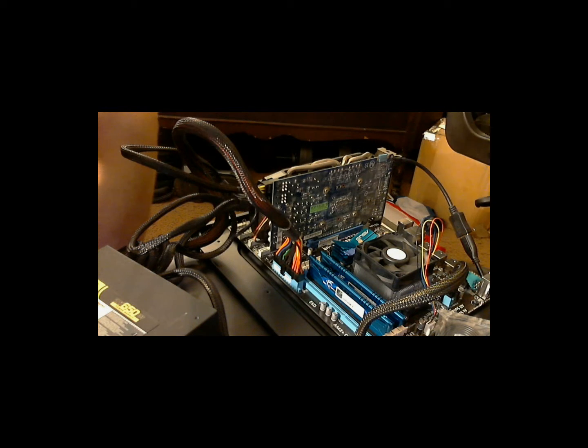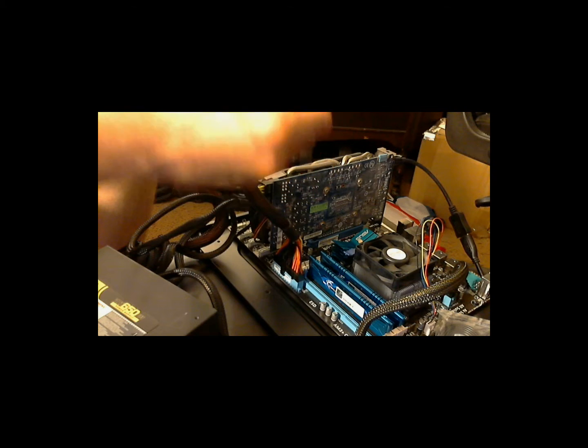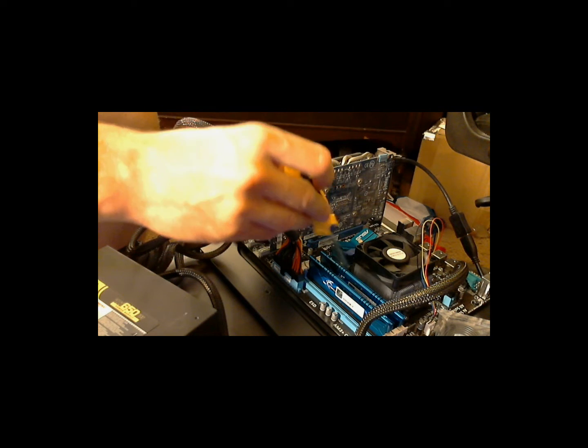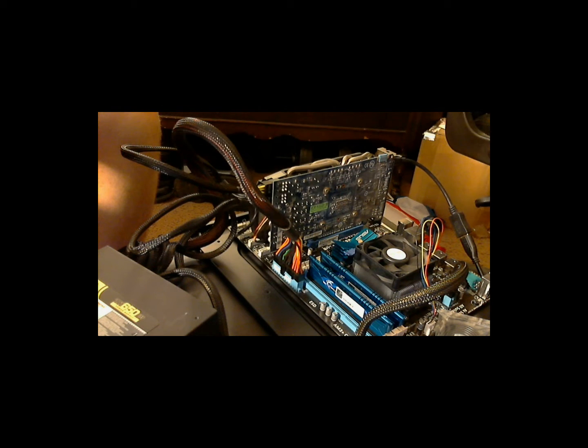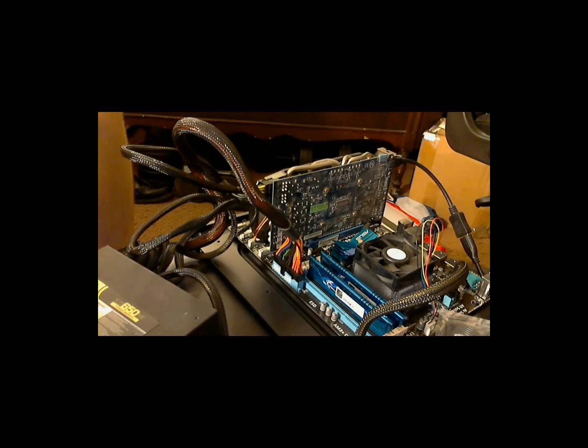Okay, so I have everything fitted on that little motherboard tray from the XB. So I have the CPU installed with a stock cooler on it. I have a graphics card, it's the 560 Ti I pulled out of my main rig. Got the 2 sticks of RAM here, it's 8 gigs, 2133. The motherboard itself, obviously, and I have my 650 watt power supply right here, powering the whole thing. So I do have the switch turned on right now. And basically all I'm going to do is I'm going to trip the system so that it turns on.